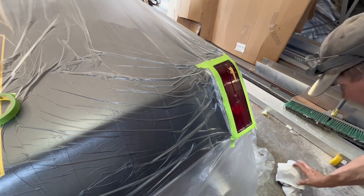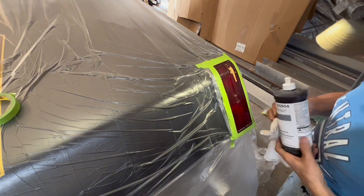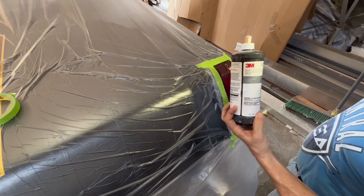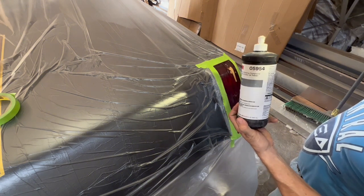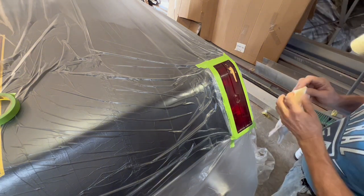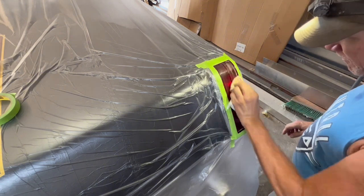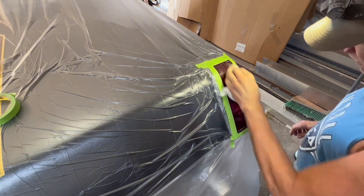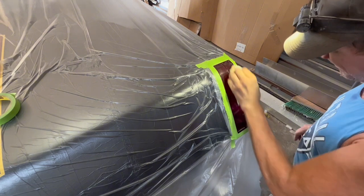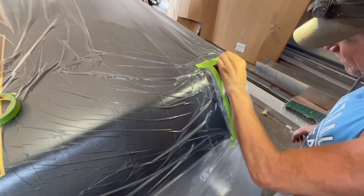After the masking, the first step is to get the taillight clean and scratched up for the clear to stick. I'm using 3M 59-54 real gritty super duty compound that'll scratch that plastic up so the clear will stick good. It'll also get off any haze and residue on this lens from 47 years of wear and tear, so I'll scratch it up with this first, which is also cleaning it at the same time.